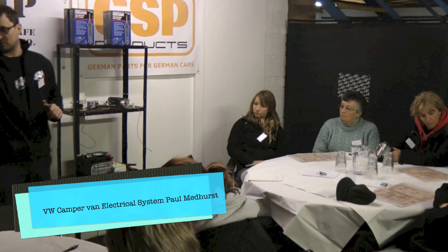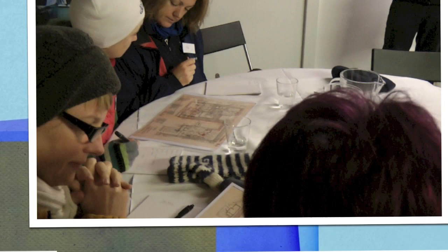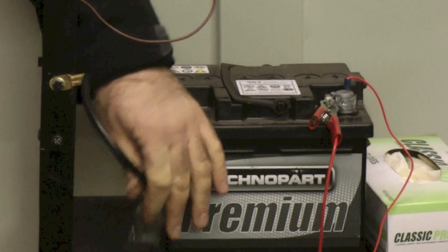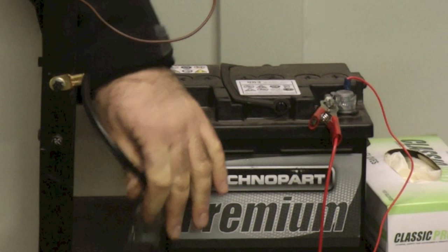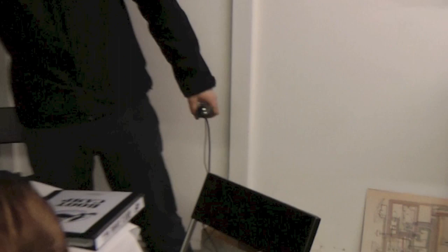Today I'm going to plan to teach you the basics, and armed with the wiring diagram you've got there and a few other things, with a little bit of revision on your behalf when you get home, you're going to be able to certainly fix things. So you've got the negative side of the battery on your campervan, and then you've got the negative terminal which, if you look in the back of your campervan, you'll see the negative terminal just goes straight to the body of the vehicle. And then the positive one goes off via the complicated route back to the component.